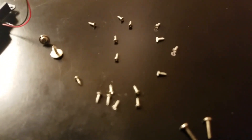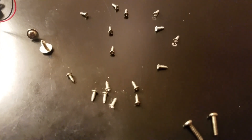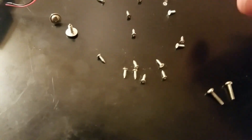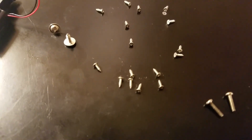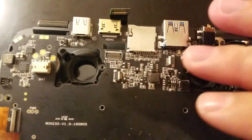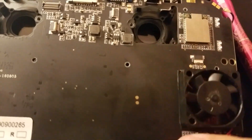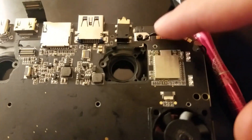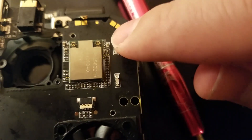It's actually kind of nice that all of the screws are pretty much the same. The six screws that hold the case together are those, and every other screw is basically the same size — take a picture if you need to when you're opening it up so you remember where all the screws go. These two hold down the analog sticks. These two long screws are for the fan. This is the LCD cable and the Wi-Fi cables — you can just lift on the side. They really designed this nicely because there are channels where the Wi-Fi goes in so it's neat and not dangling around.